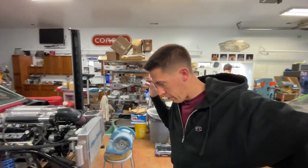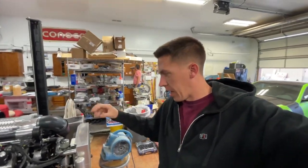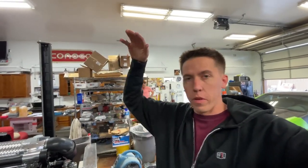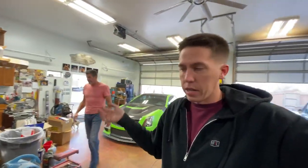So just got off the computer and phone with the Borowski guy, Tim. He was a huge help. They actually had to position the throttle blade open a little bit more to get it to start. This thing has a pretty aggressive ramp on the startup, and then it comes down and idles, probably because of the big blower, a little surge, but we got it dialed in pretty good. We're going to work on it some more once we get the car down under load and we can drive it.